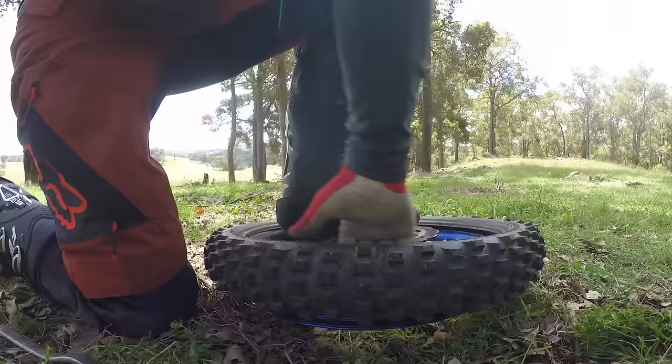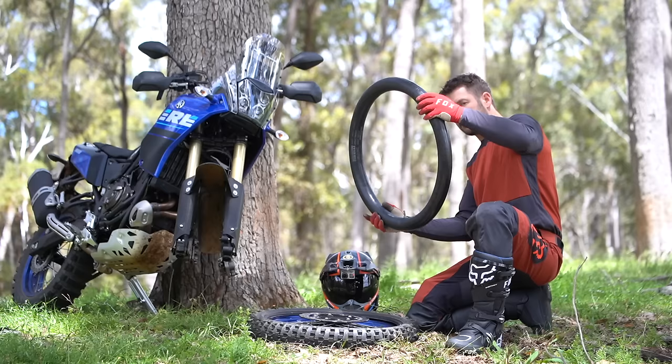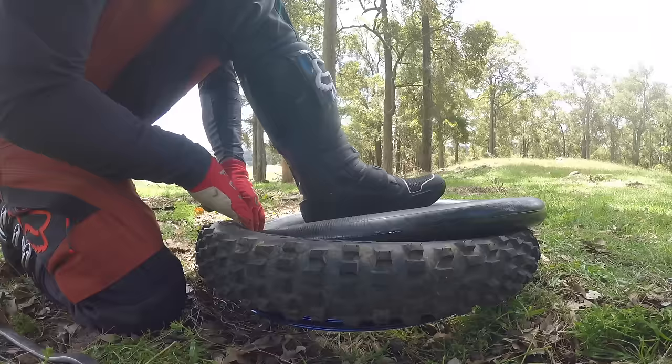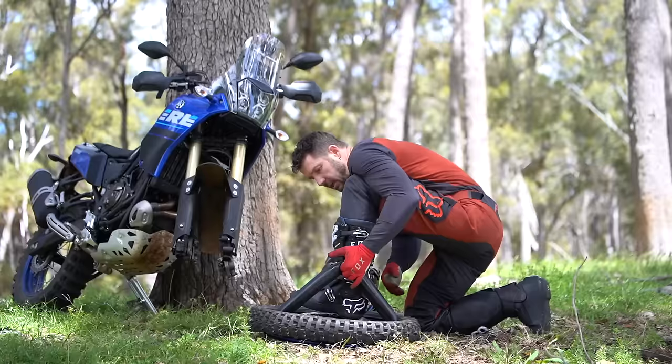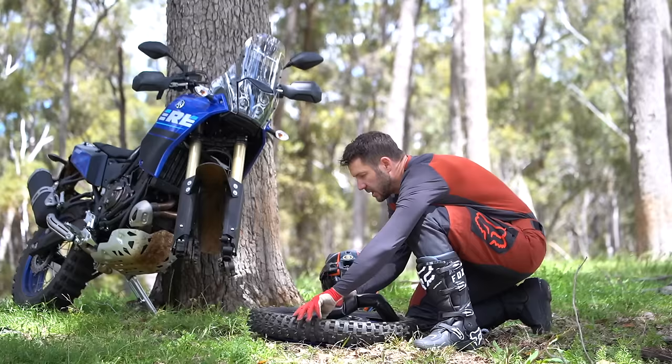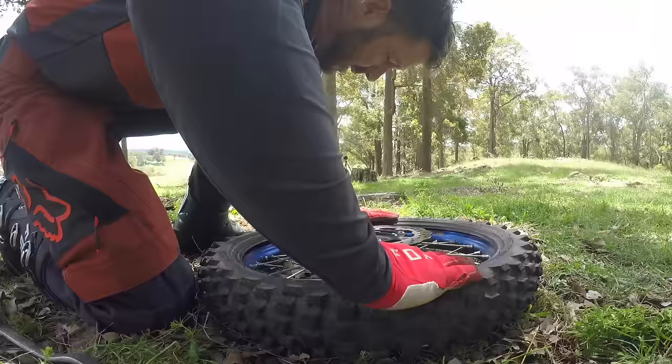Pull it up — you've got full access to the valve. Just go around to the valve, flick it out. There's my tube. I'm not going to use my spare because I don't need to. Easiest way: just poke the valve in there, get the rest of the tube in. That there is a perfect amount of air — you want about that much air in it just to keep it, because if you put it in floppy it can fall against the bead and it's easier to pinch. So that just sits in there, and the tyre just swallows up into the valley.